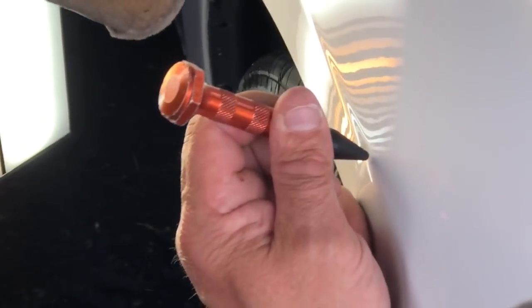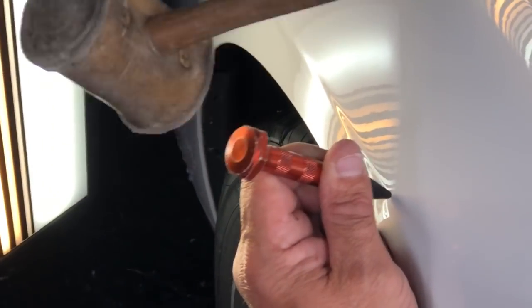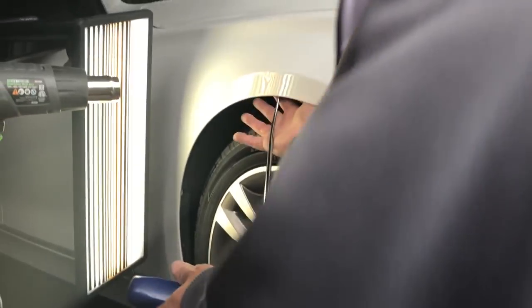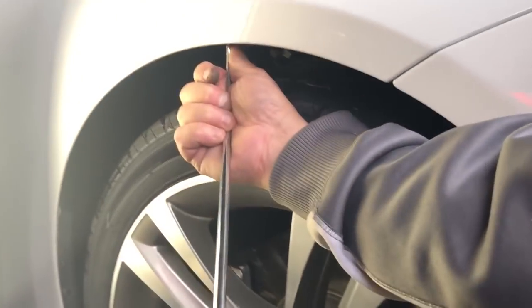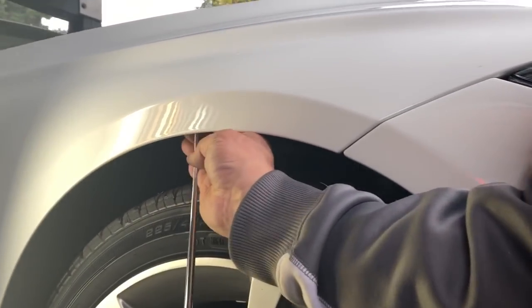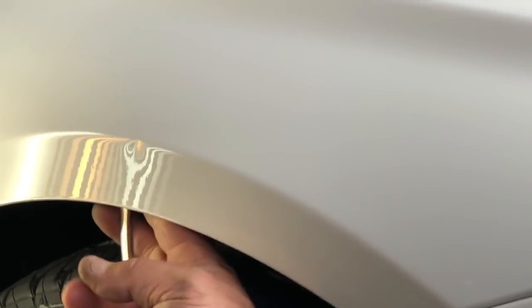Just breaking that brow down, because if I go to push this thing out and leave that brow up there it's just going to make this tighter. What we want to do is brush this out real nice, get it back to warm again. I have tool number one stuck in there, kind of snuck up underneath the liner. That's starting to move a little bit. Let me come down here and see what we're looking like — I don't want to make any severe pushes, just finding my tool in the center.